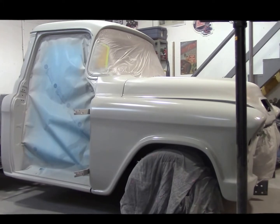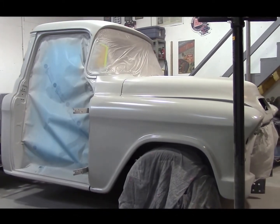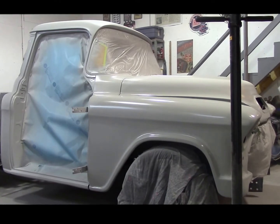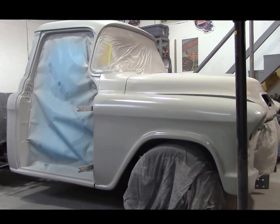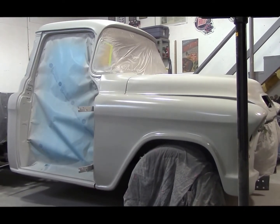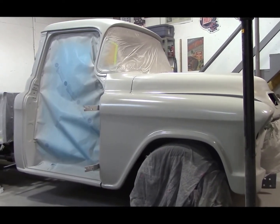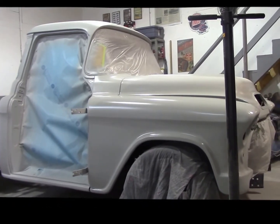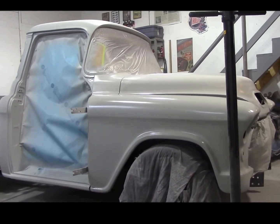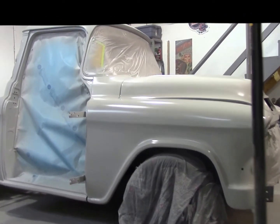If you're out there Tim and you're watching — your '57 is primered now. That's finished off in 80 grit and then primered with a filler primer. Next we will block it, finish it in 180 grit, then reprime it again, and then we'll drop it down finishing with a 220, a 320, and then usually finish it off with a 400 — sometimes a 500. Then it'll be ready for paint. So there's the first major filler primer done.